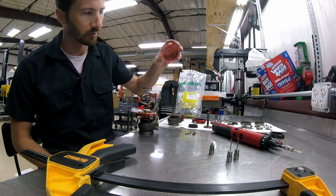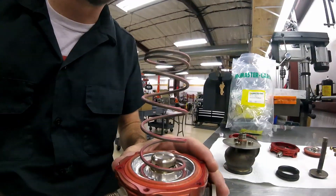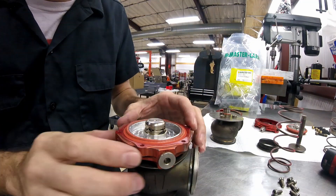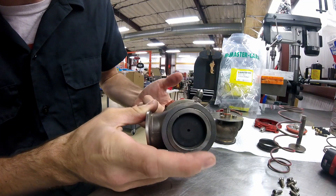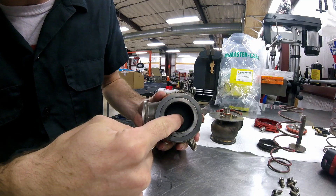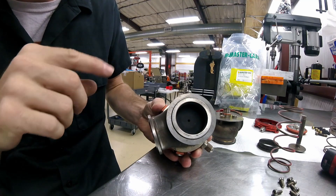Now I've got those taken out, I'm just going to release here while I put a little pressure on it - just like that, there we go. That could have been a disaster if you hadn't known that was going to happen. Once you do that the spring pressure is released and you can just take it off. You'll see the spring is sitting on the diaphragm perch - that aluminum piece in there. You can just pull the spring off no problem - see, it's a red spring as well. Then you've got the diaphragm here. The valve is pushed down against the seat by the spring, but when there's exhaust pressure the exhaust gas is pushed up against the valve.